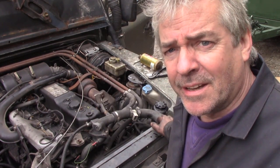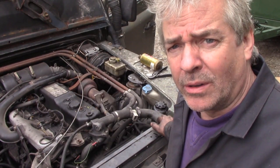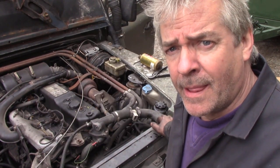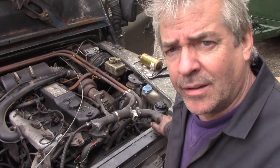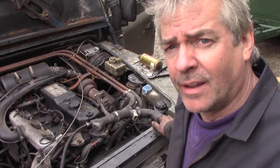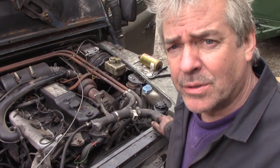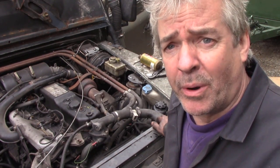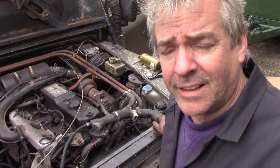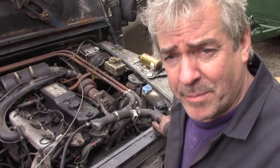So I had an idea. The TDI one was a bit small, but it had a longer stroke. Now, the bore was knackered on it. What if I got my good old friend JP to bore it out and make a new piston with a seal on it, even a hydraulic seal from a proper jack, and then we could compromise halfway between the two. I think that might be the way to go.